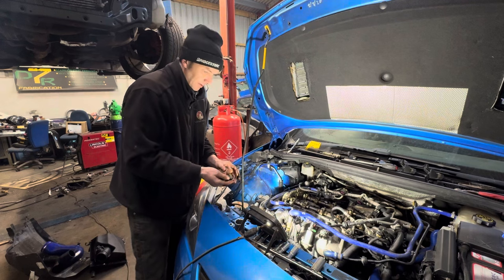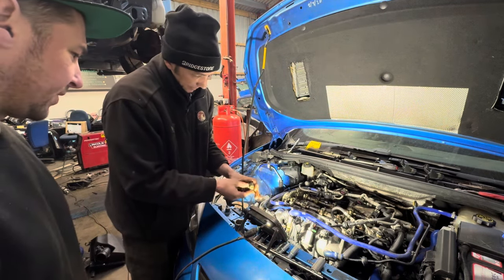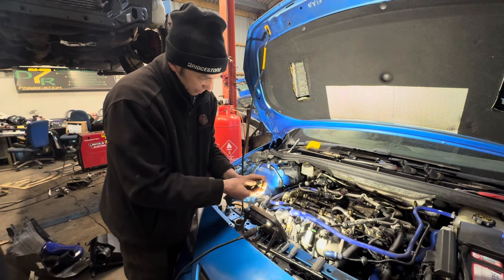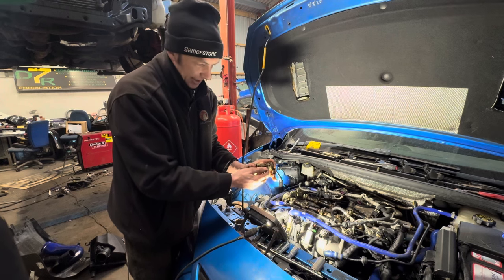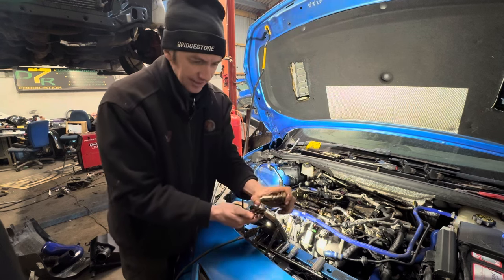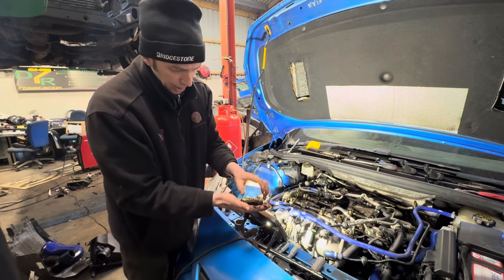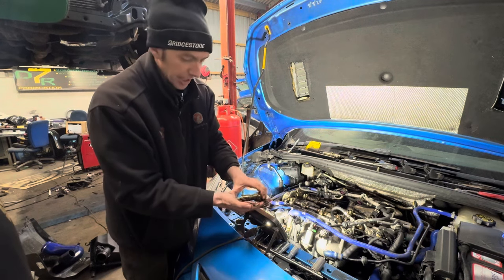Well then, Colin, look at that tensioner, it looks pretty slack. Especially, you can push it with your hands. I've seen you do these before and you almost have to go in with a vice. Yeah, it's normally quite rigid. Normally, once you put it in, you'll struggle to actually get it to the depth of getting the threads in. It can be a very tricky item to put in. And as you can see, it's lost its compression, hasn't it? Yeah, I can push it quite freely. I'm not having to put a massive amount of force onto it. So it's without doubt a bit weak in comparison to a brand new tensioner.